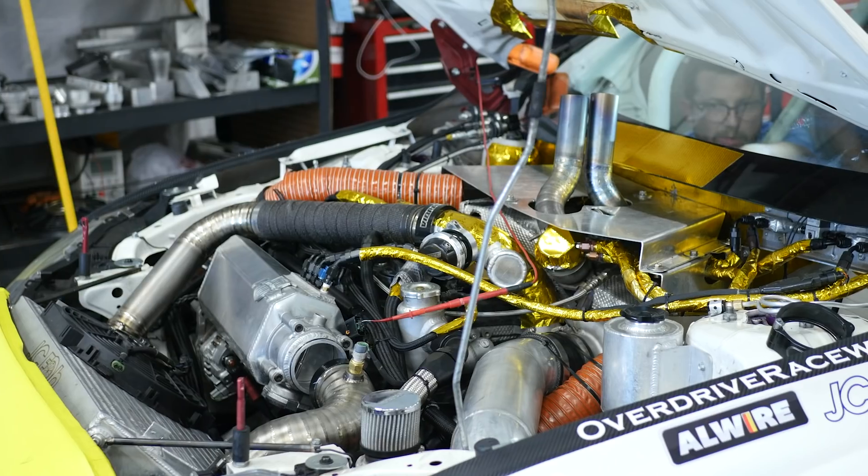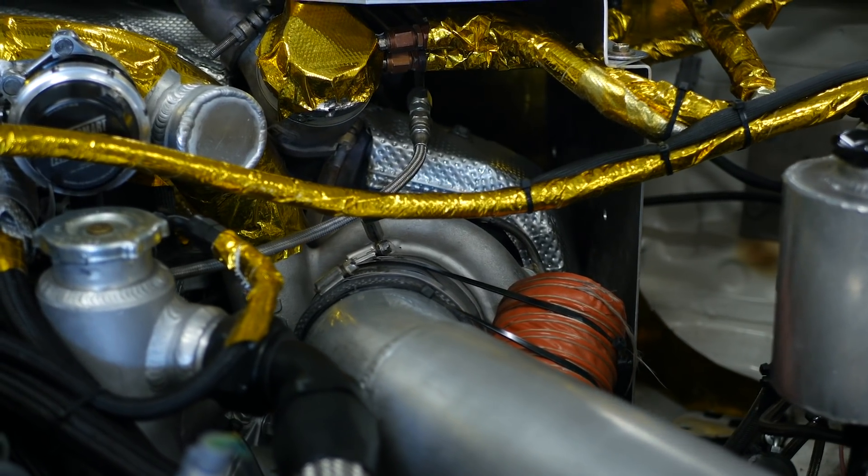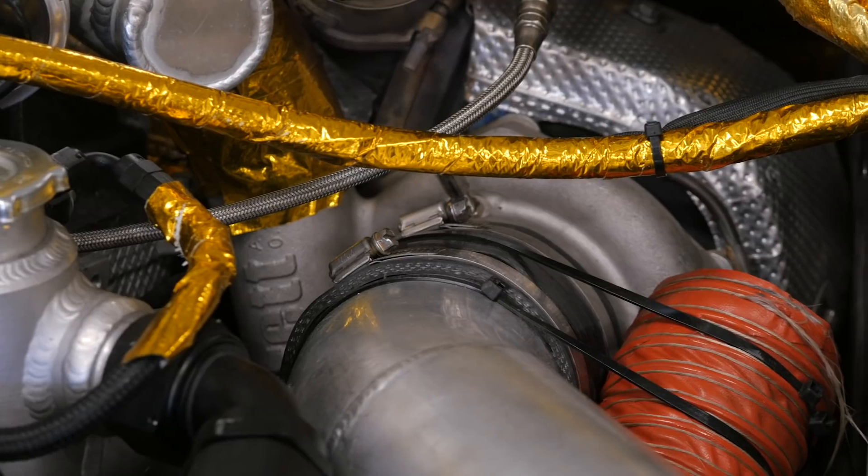In this particular application on a Mitsubishi 4B11 engine, the engine is turbocharged and this means that the sensors are fitted to the exhaust manifold pre-turbocharger. This isn't the ideal environment for wide band air fuel ratio sensors because they're exposed to high heat, which can shorten their lifespan.